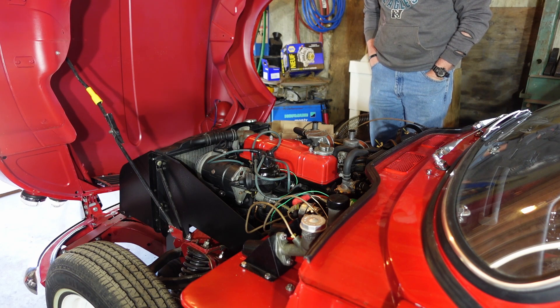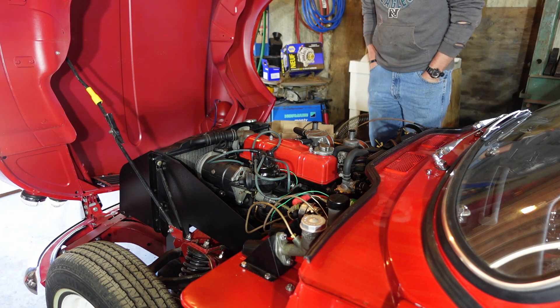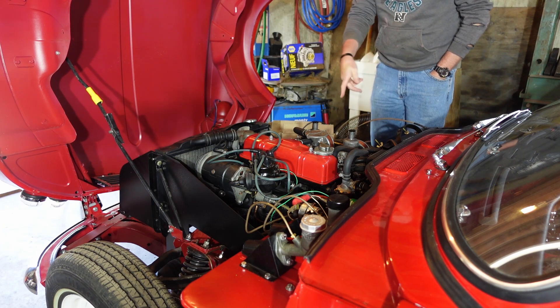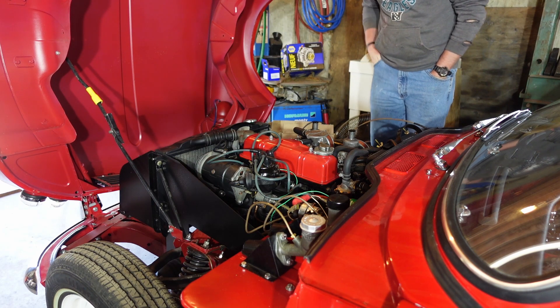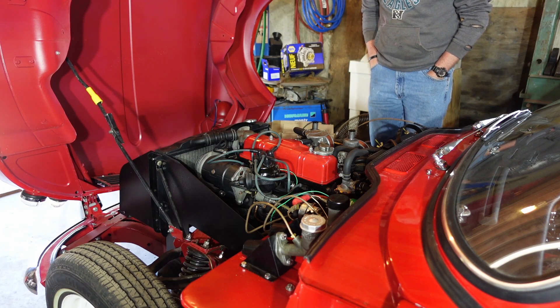So we're going to do valve clearances. Yesterday I was here and tried to take it out. I pulled the plugs and looked at them — number two was a little bit wet, but the rest of them looked good. I had spark at all four of them, but when I pulled the plug wires for number three and number four, nothing happened — the engine didn't change characteristics at all. I did check the fuel floats and that looks good. I put my hand in front of the carb and it about sucked my hand into the motor, so that was good. So I'm not too sure what's going on, but we'll see if we can figure it out. First thing up, we're going to do valve clearances.